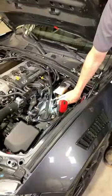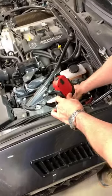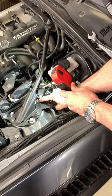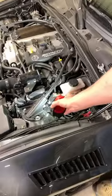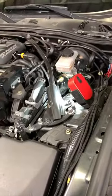Are there any interference issues with aftermarket shock tower braces? That's a pretty wide open question — not that we're aware of. It is tucked down pretty far. You can see this is the stock shock tower brace, but it's got quite a bit of clearance there. The only thing to be aware of is this bracket that the shock tower brace actually bolts to — you need to retain that, because this little tab off of that base plate is where the master cylinder brace bolts to, and the ECU as well. Assuming you still have this plate, it will probably work with most aftermarket shock tower braces.